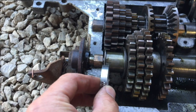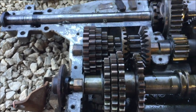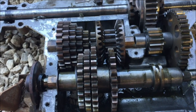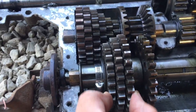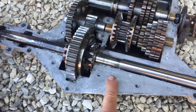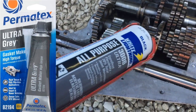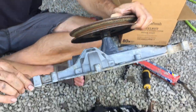What we have to do just to keep this thing running and keep these gears lined up is to keep them pressed over. So we're going to put some hose clamps on here that will hold these gears in place. As it turns out, you don't ever mow in sixth gear anyway, so third gear will be plenty to mow. There's the hose clamp in place holding these gears nice and tight.